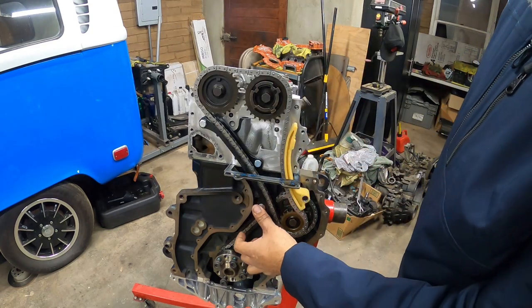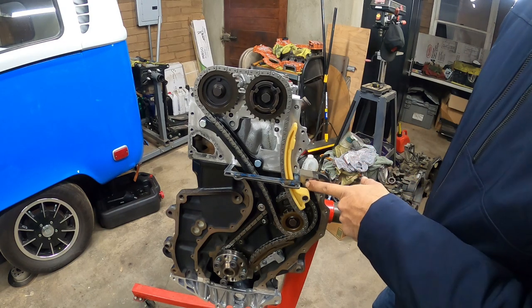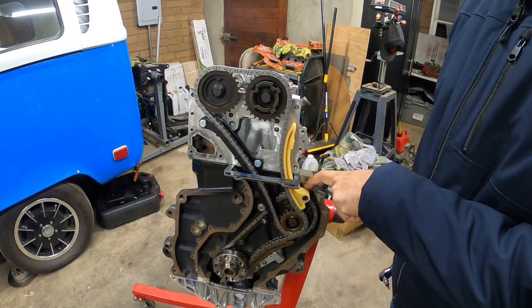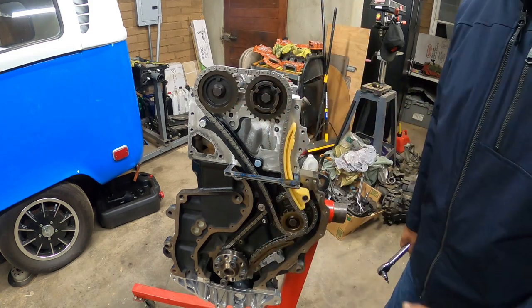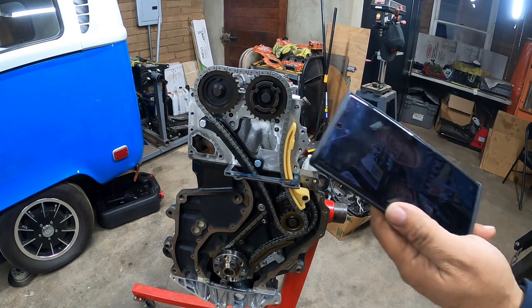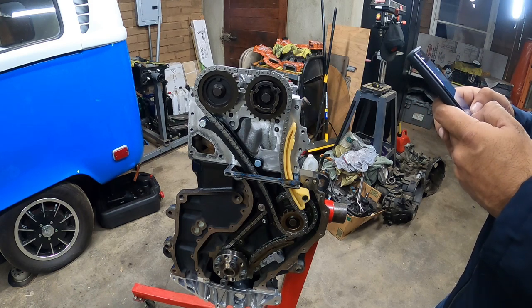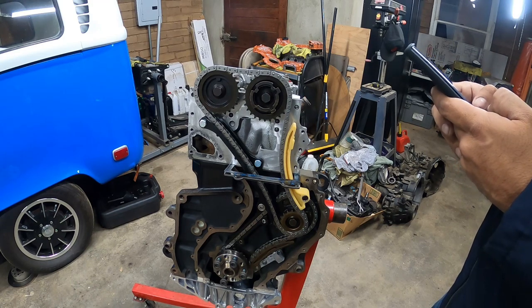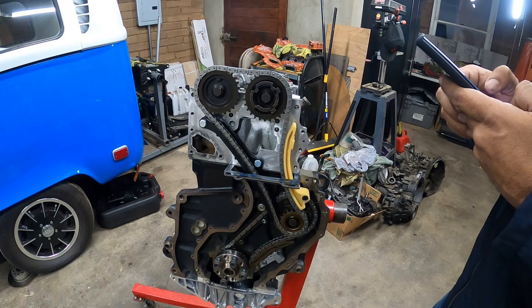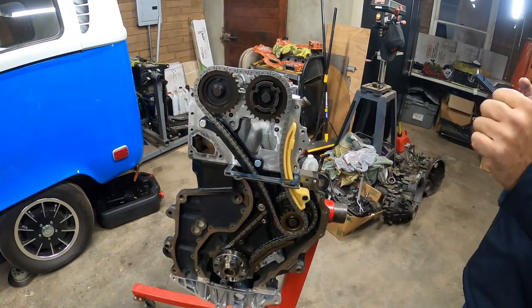I'd just double check your conversions. There's one more bolt right here — I'm not going to be able to torque it now because I torqued it prior to installing this, and I'm not taking this whole thing apart. That's one thing you guys need to remember: this one has to be torqued down before anything goes on. That's a bearing bolt and it's 18 Newton meters. And that's it — everything's timed and set. We're ready to go.